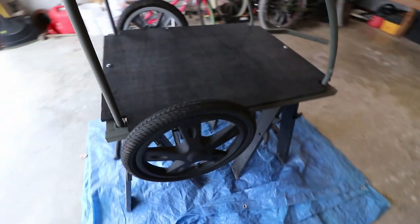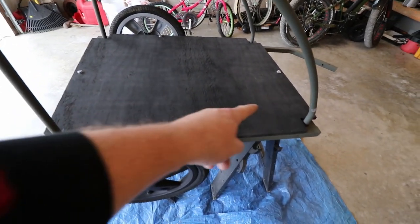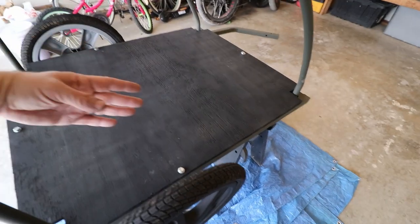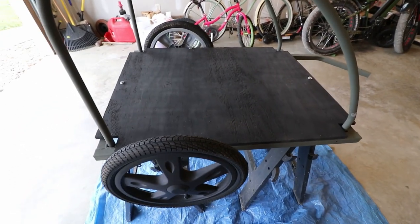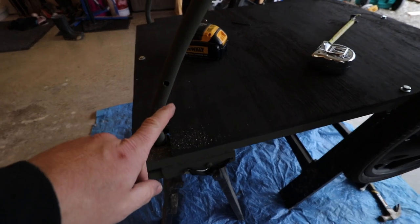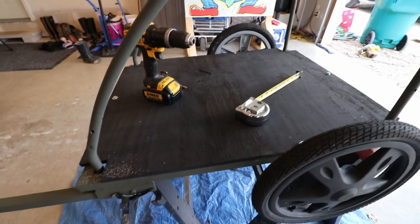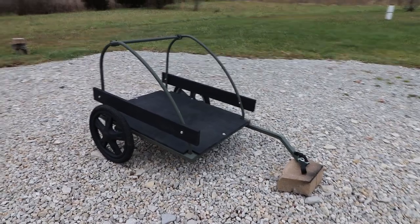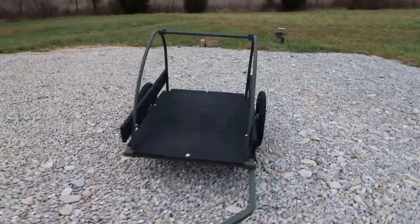For one final thing, just for extra support and a place to strap things to, I'm going to run some side panels on the frame to keep gear from moving left to right and give me more spots to tie stuff down. I took some pine boards, painted them black, ran a couple pilot holes through, and attached them as sideboards. There's the finished product — sideboards installed, floor in, all painted.